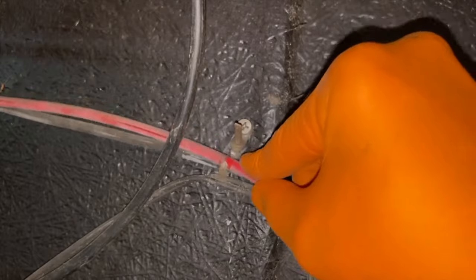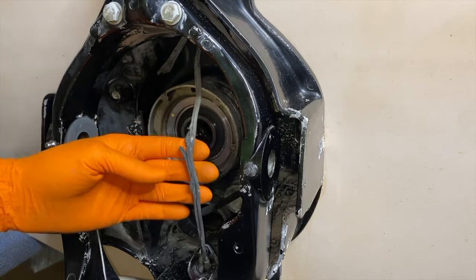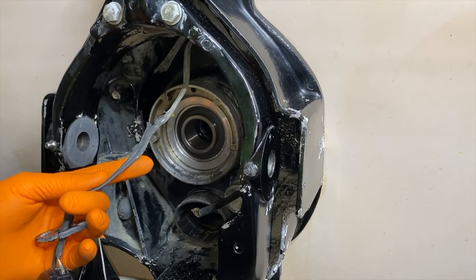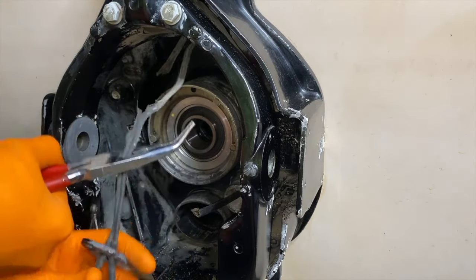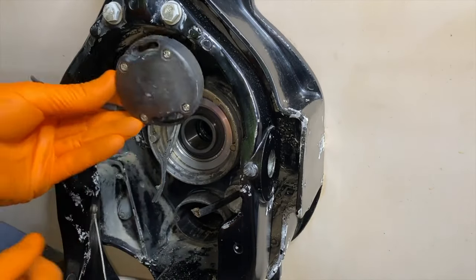With that cut I will remove the wiring. I'm also going to reinsert that red cable — and again that feeds all the way to these two connections right here. Obviously you want to ensure your battery is not connected — our battery is not even installed in the boat. I'm going to snip the wiring. Again this was the trim sender starboard side. I'll remove the clip — and this is now junk.